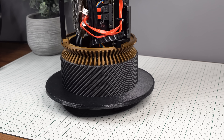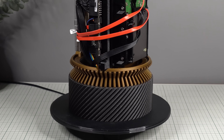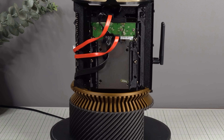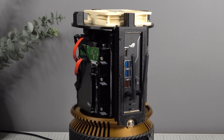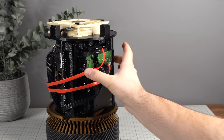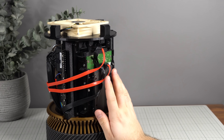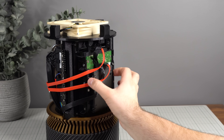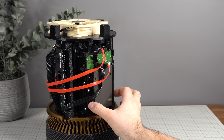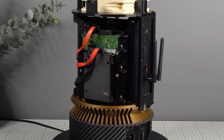There is also an alternative option: one 3.5-inch hard drive combined with one 2.5-inch SSD. This mount uses the same four holes as the SSD mount but clamps onto the sides of the hard drive. The extra SSD can then be secured directly onto the screw holes on the hard drive itself, making for a compact mounting solution that fits perfectly within the round shape of the case.